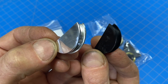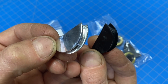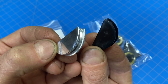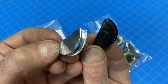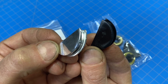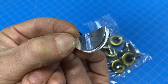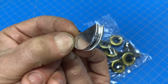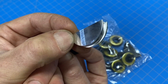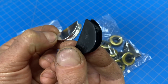That's the exact reason the aftermarket industry actually designed and started fabricating these in the first place — they recognized that when their cars got hot, especially with high performance use and their engines got really hot, these valve cover seals would often fail because they weren't expanding as much as the aluminum around them. Lick Motorsports here in Northern California is one of the first guys I saw produce these. They recognized that if you could make these out of aluminum, these little wedges would actually expand the same amount that the valve covers and the heads would expand, because they're also made of aluminum — meaning everything is going to be expanding and contracting about the same amount.